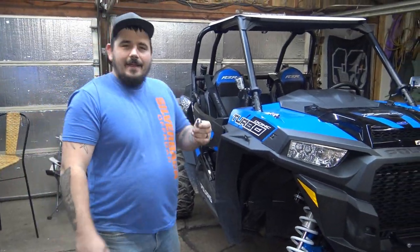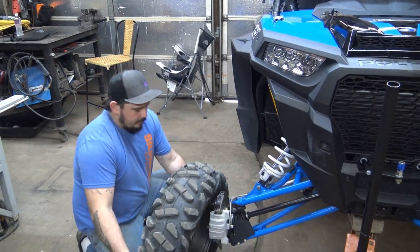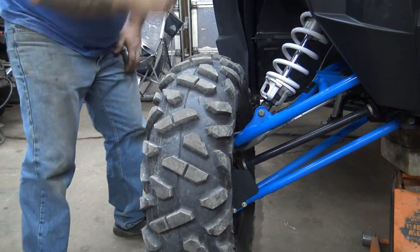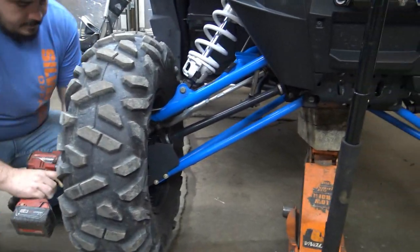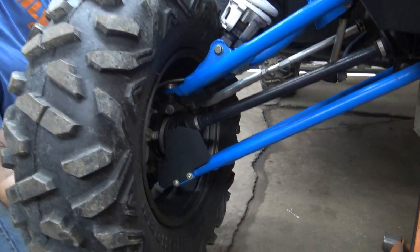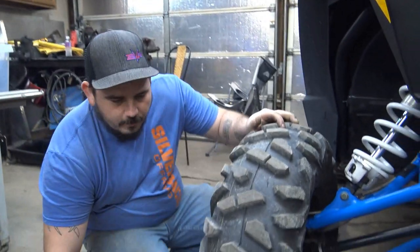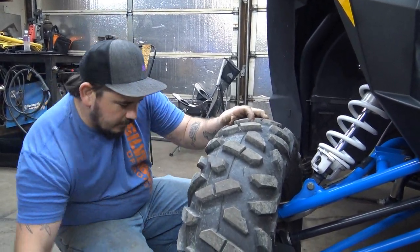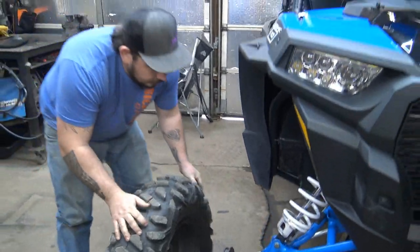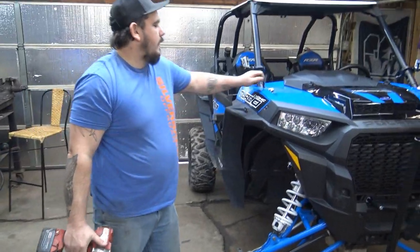So what are we doing today, Tim? Oh man, I should have showed them. We could show them the play and the ball joints. Yeah, let's do that. I'm just going to put two lug nuts back on here real quick. I don't remember what side had the play, but for sure I think they both had a little bit. So if you tighten up your tire, obviously you leave your tire bolted on — yeah, it's easier to see. So you should be able to see it now, right? Yeah, you can see it wobbling back and forth. It's got play. Both of them had play a couple months ago. The thing is, this thing just runs down the strip. They still need to get changed out, but it's not as big of a deal. But we want something good on here. We didn't want to put something too heavy on here — obviously we're trying to keep this thing pretty light, keep it rolling down the strip. But what we're doing is we're doing ball joints.